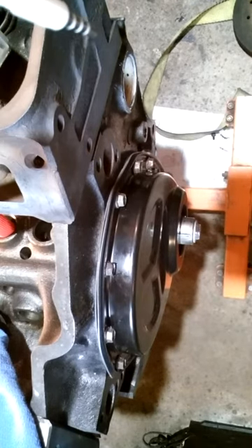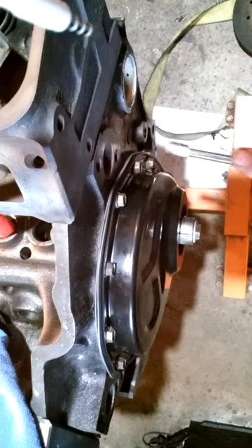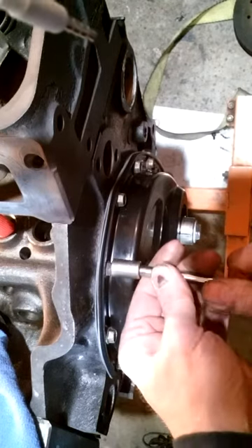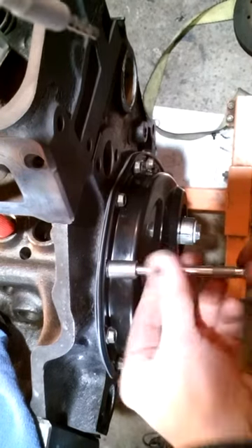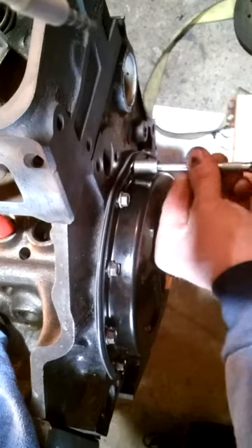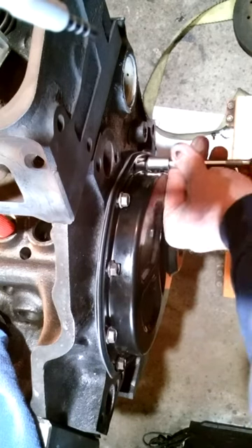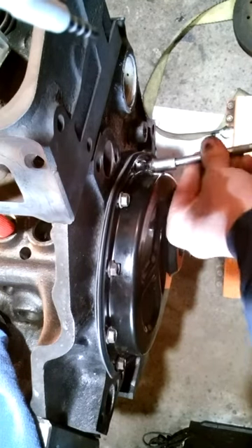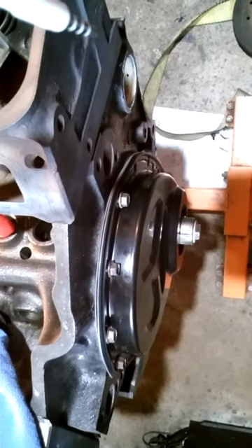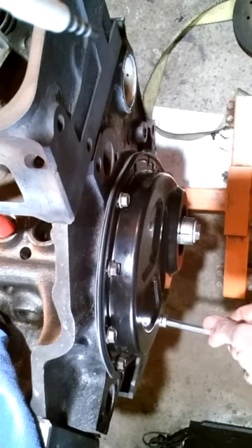Let's put one more bolt in — this will push against the button and we'll be able to see our play with the camshaft all the way back. The way you can move the camshaft forward if you've got too much play is you tap the freeze plug in back, the cam freeze plug which is right where the camshaft is. If you need more play, you tap the camshaft to pull the freeze plug back. That freeze plug is all the way back so we have no extra room. We had a smaller cam button but it had too much play, and you can get them in nylon or metal.